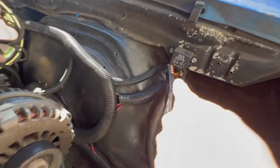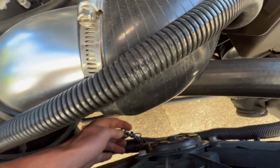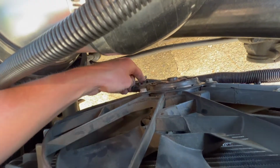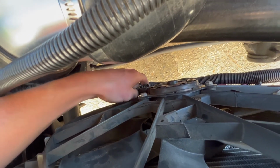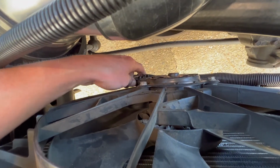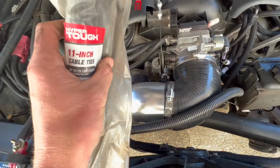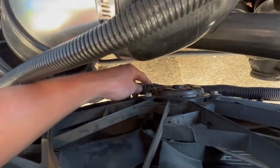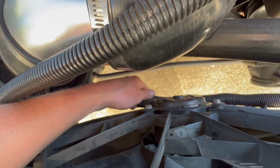All right, so what we did is we took this jumper cable and connected our 2 lugs together. We tested voltage. Our voltage is good, but you're gonna see something. When I plug it in, ooh, now we're not getting it. We've got an issue with our connector. We just had it working, so I'm gonna play around with this connector. We're gonna have to order a connector, so I'm gonna try to zip tie it in place. Also our jumper might not be touching right, but anyways, verified something's wrong with the connector. We'll do this temporary fix until we can get a new connector.